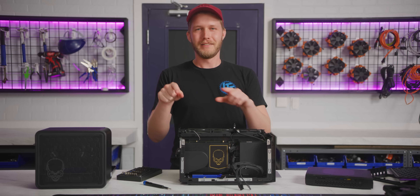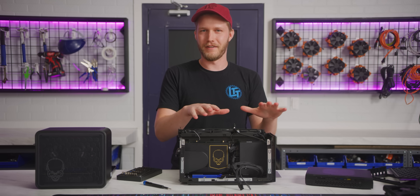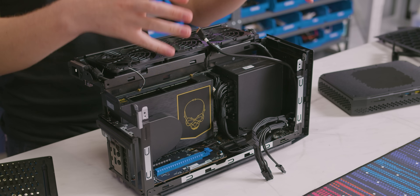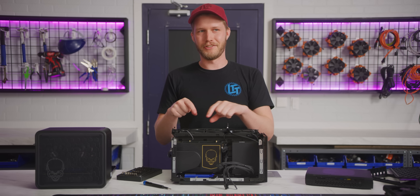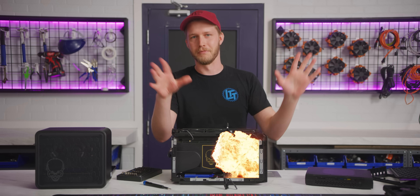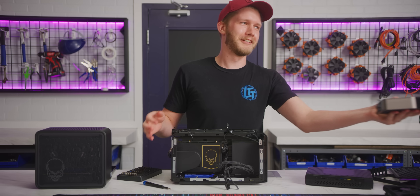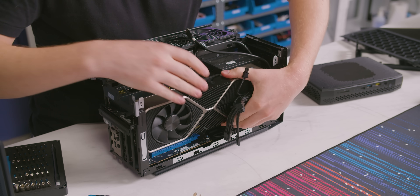So we have a 3080 Ti here. Are you sure about this? Yeah. In the past, if you had a power supply that was kind of marginal, it was totally fine and you could sort of just do it. But in this situation, the problem is that small form factor power supplies, because they're small, have less capacitance. So if you have something like a 3080 Ti and you chuck it in there, it draws 500 watts. The power supply doesn't like it — it goes boom. That happened to Andy's and James's and the Billy Billy PC. We've killed a lot of small form factor power supplies lately. We're just doing 3080 — we're playing it safe. It will fit. I guess we will find out.